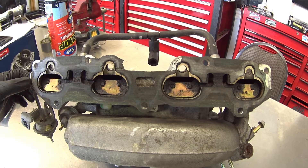I wanted to share a few more in-depth details on the VTCS system. This still shot shows the valves mounted in the runners in the closed position. When closed, there's 90% blockage occurring. This default position occurs when the engine is cold and running in open loop. It works by pulling air over the top of the valve through the small openings. The amount of air that comes through is reduced, but the velocity of the air charge is very high, and since it comes over the top, it naturally tends to curve downward — tumbling, rotating into the port.